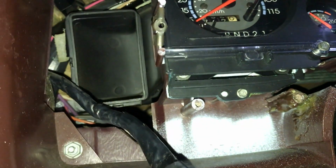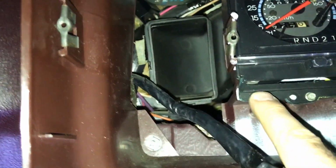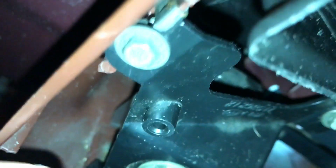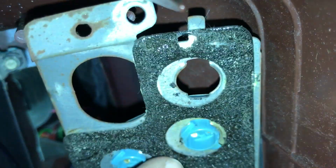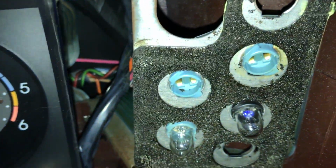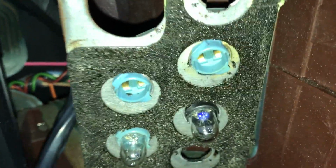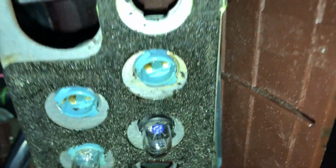And then don't forget the one that's actually behind the gear shift indicator. You have to get that one in, and then you can put the gear shift indicator over it with these 2 fasteners here. And then last, you've got the single screw for the duct piece that goes in, and then the 3 screws for the light switch. And then don't forget the gasket that keeps the light, depending upon what you have activated, say for instance if you have the brights activated, from bleeding in to the other indicators on the front of the bezel. If you don't put this in, you turn on your brights, you'll see the other indicators or windows slightly illuminated because the light will bleed through. So make sure you put that back in.